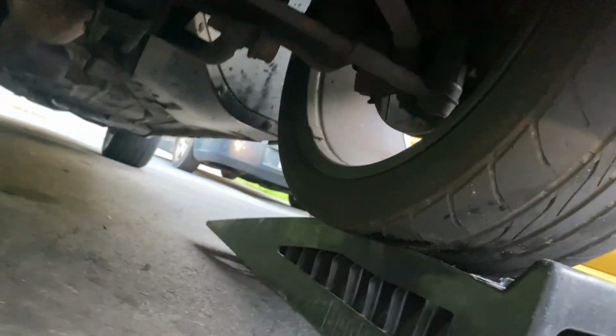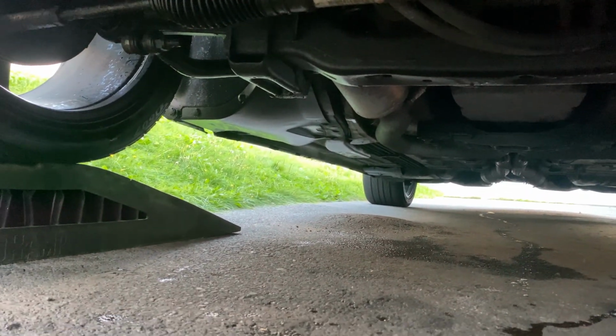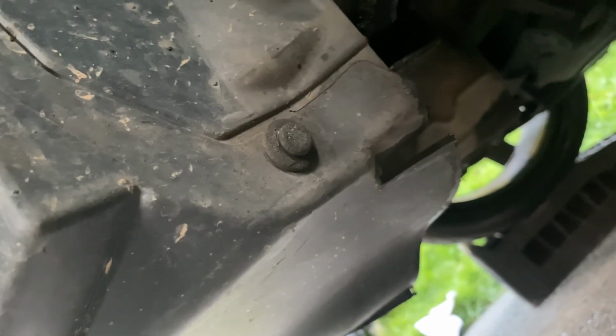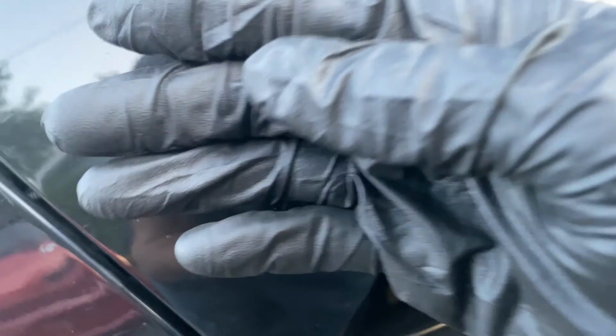And as you can see, it's dripping. I'm just gonna undo these clips here so the bottom thing can come with it. And same for the other side. Alright, so I popped off all the clips and I took out the 10mm bolt that's right there. There's also a 10mm nut on the other side, on the inside. So you gotta pull the inner liner down, reach up in, and undo that on each side.